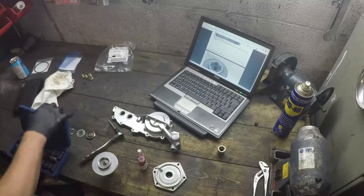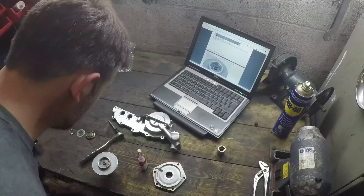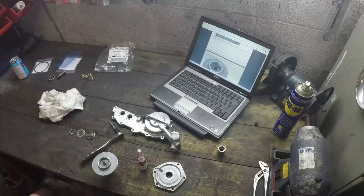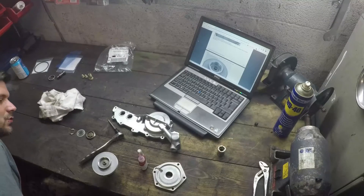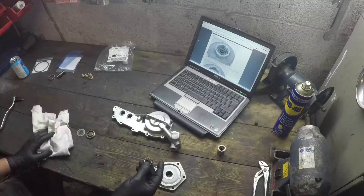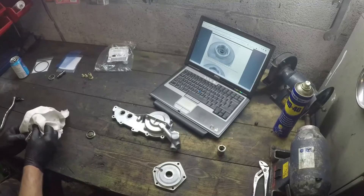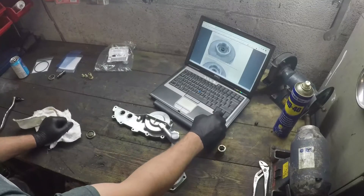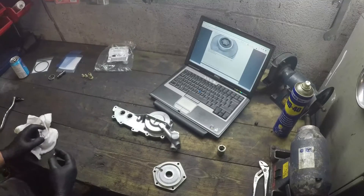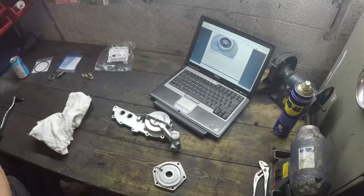Now I want to use the vise just to make sure it's absolutely correct. We don't want to just bang it in the vise — it tells you to use vise jaws. You can use whatever you want to protect the piston and the associated body when you come to clamp it. I've used a couple of bits of rubber hose, rubber coolant pipe. The next step is this nice bearing washer — it wants to go this way up again according to the pictures, and then the next washer on top. Again I'm putting the worn side up away from the bearing, and then finally it's going to be the little cap. Install piston bolt and cap, counter hold the piston and tighten — only hand tighten it says. This is regular right tighty lefty loosey, and this is where you need your special socket.